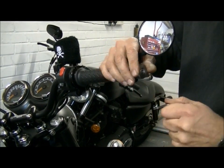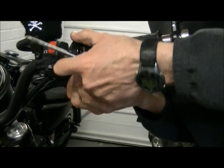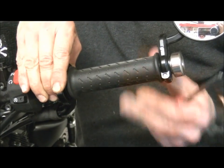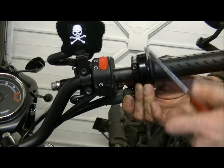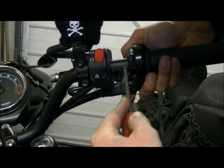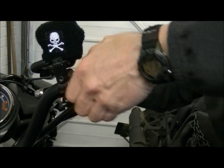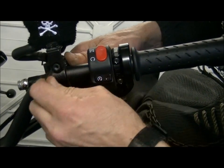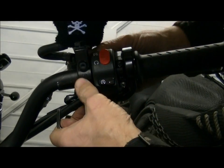That's it. I'll just come and set that height in a minute. Let's get a screwdriver. Okay. So I'm just bringing the twist grip body out to there. Be careful obviously that when it does, you don't trap it like that so it doesn't spring back. You need a little bit of gap. Here we are. I think I'll change those for Allen bolts in a minute. There we go. Now lastly but not leastly, switch gear out. And then the Allen's there. And again, we can just slide that out. Excellent. Here we are.